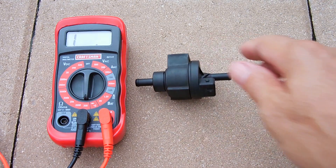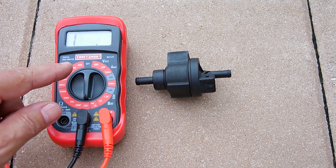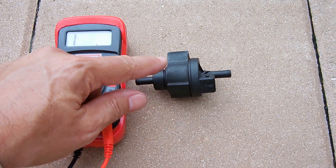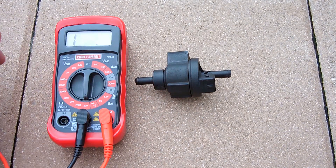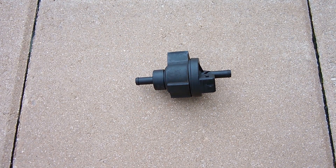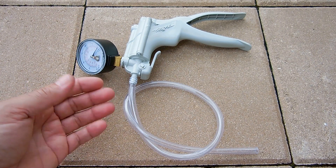Yours should be a little higher or a little lower, but in that general range. If you check with a digital multimeter and you have no resistance showing up at all, that would indicate that the solenoid winding inside is open and you're going to have to replace it.